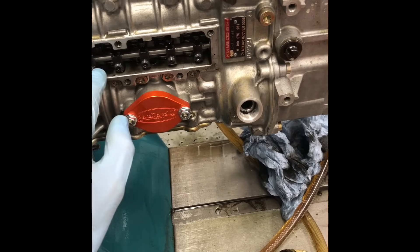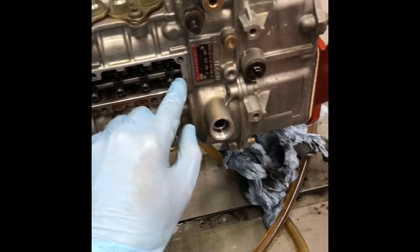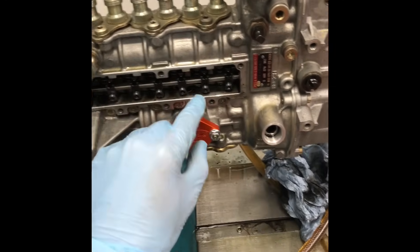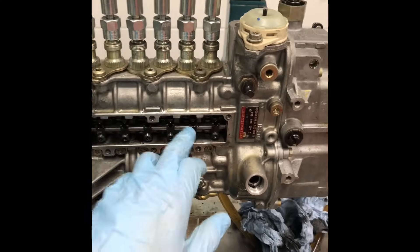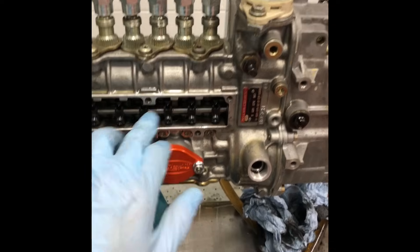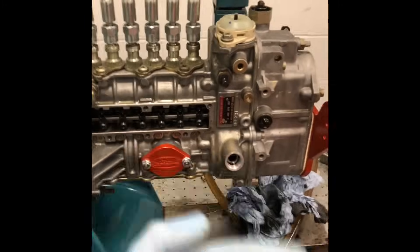All we want to do is give a sort of a puddle along the bottom, because it has quite a large drain hole there as you can just see. So the oil can get away — that's not an issue. But what we're wanting to do is create a bit of a puddle that just slows that rack down so it doesn't have the ability to jump and jerk, which causes that horrible bonanza effect, which is well known in the super turbo diesel world and is a big, big problem.